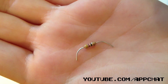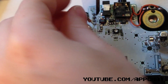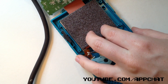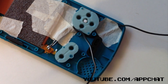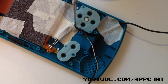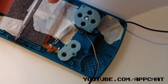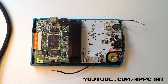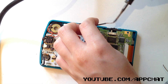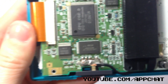You may need to shorten the ends of the resistor and bend them down so it's this shape. We're now going to solder it into your Game Boy. We're soldering the yellow side of the resistor to the top metal blob and it should look exactly like this. Put the Game Boy screen into place over the top of the front light — I stuck that down with some masking tape. Now flip that orange tab over gently and snake the top wire down and around the D-pad to the bottom of the Game Boy, soldering it to the resistor. The bottom wire is snaked around near the buttons and soldered onto the on/off switch. Put the circuit board back in its original place and solder these loose wires.